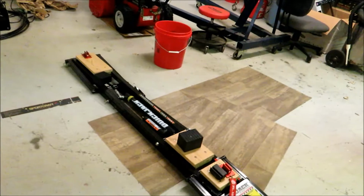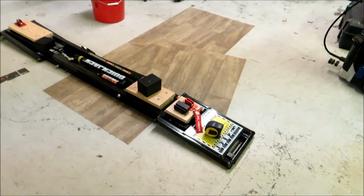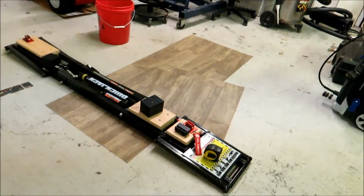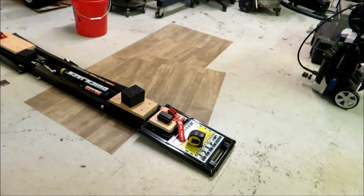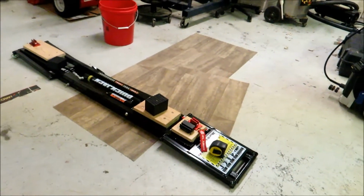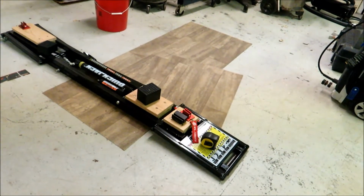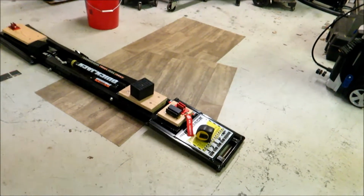So with all of that being said, over the last 7 minutes, at this point, my only recourse is this. I'm sure there will be people out there that will say there are other options, and that's great. It's your car, you can do whatever you want. For me, to do what I want to do using those wooden blocks, not having to worry about perfect placement of the rubber blocks, putting stress on the side skirt and all that other fun stuff I already talked about, the only option I have at this point is to actually make a notch on the skirt underneath the car to match as far back as I can get, and use the original red pinch weld adapters.